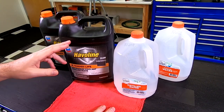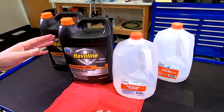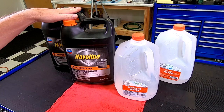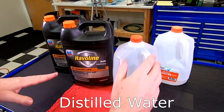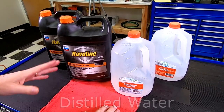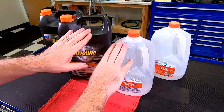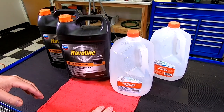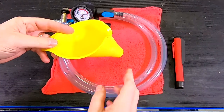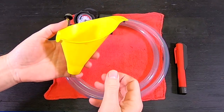It comes in two formats: concentrate in the black bottle, and a white bottle that's 50-50 premix. Since we have to come up with two and a half gallons of 50-50 mix, I've got two gallons of concentrate to mix with distilled water - two gallons picked up at the local grocery store. This will make four gallons of coolant and I only need two and a half, but I'll use another half gallon out of the other batch and have some extra leftover. For tools, you really only need a funnel in the basic sense.